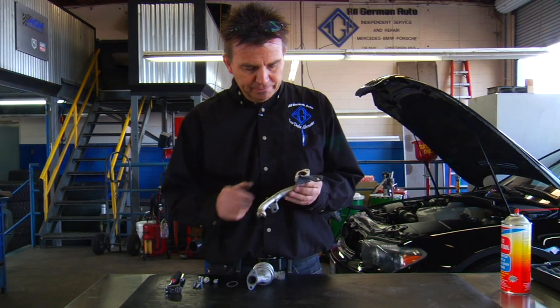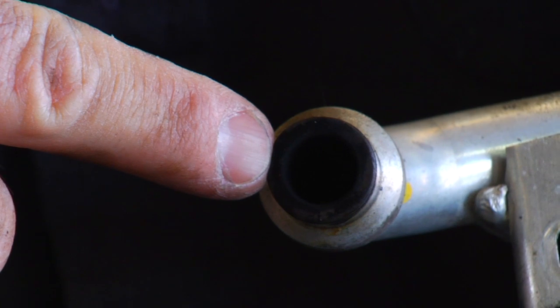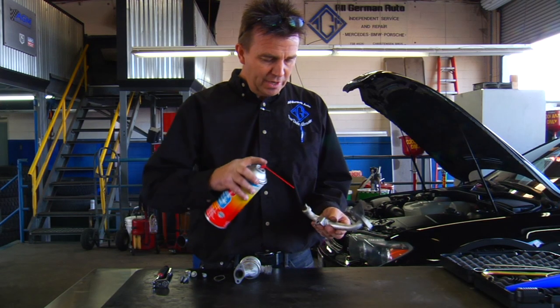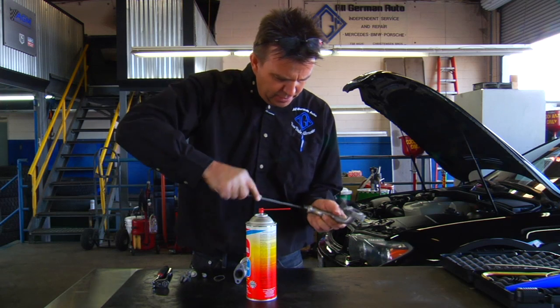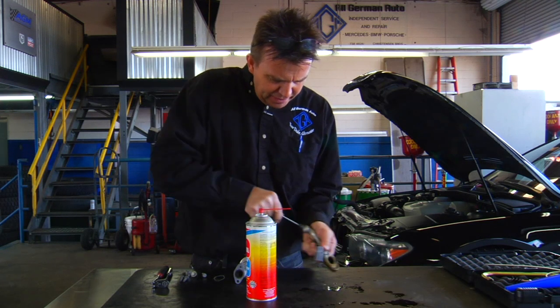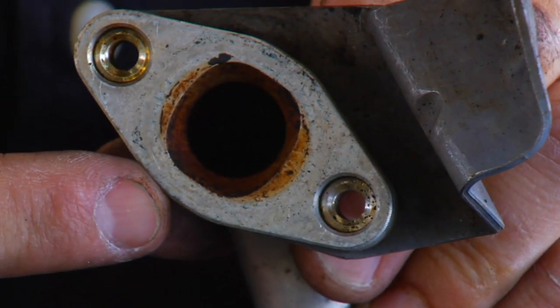The second part we have is the air tube. You can see the carbon buildup near where the valve is mounted, and you can see how severe the carbon buildup is on the end connected to the cylinder head. Here we're cleaning this part with carburetor cleaner and taking the brush from the kit and pushing it through the pipe, maneuvering it around the entire way. It takes a little effort but it scrubs the debris out. After brushing from both sides, the carbon is removed and the part is clean.